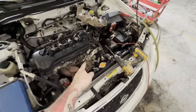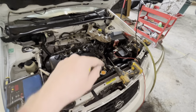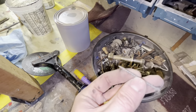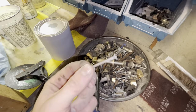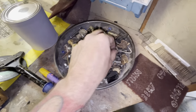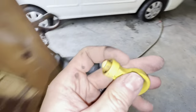Here's what we normally do: we go inside the tube and take a 1/8 drill bit, normally on a drill — usually a short one because the piece is broke off right at the top. We drill a little hole in it and take a sheetrock screw. You can use a coarse thread or a fine thread sheetrock screw. The sheetrock screw works best because a fat screw is just gonna be too big. These are really thin, sharp, and they bite extremely well into the plastic.